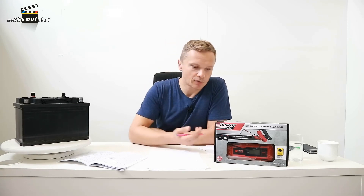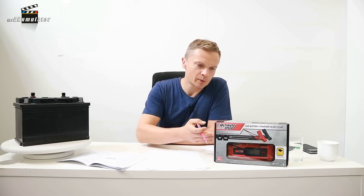At that moment I concluded that this experiment would be a failed experiment, and that it was essentially just recording material to discuss — why such a charger is unlikely to handle a deeply discharged battery, and that it is more of a cosmetic gadget. If you are not dealing with heavily discharged batteries, you can safely connect this little charger to your battery for the whole Saturday or even Saturday and Sunday. It will charge your battery to some extent — the effects won't be overwhelming, but you will have the peace of mind that you've done something to stimulate your battery.